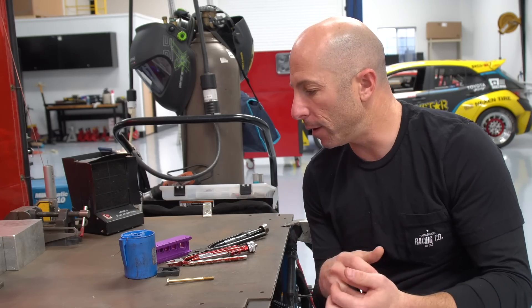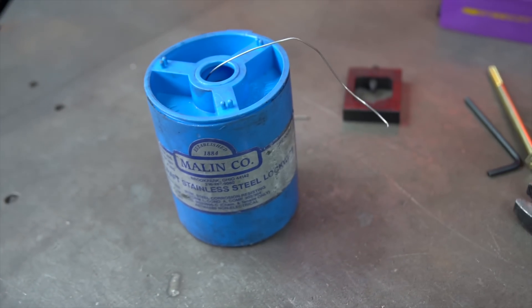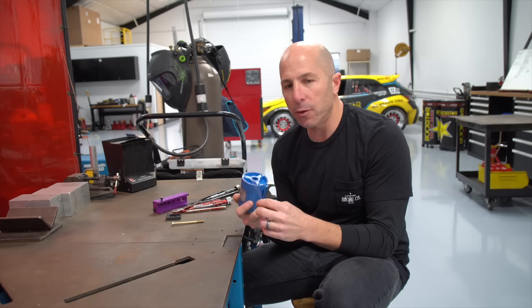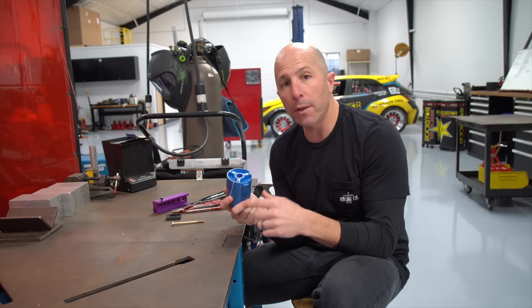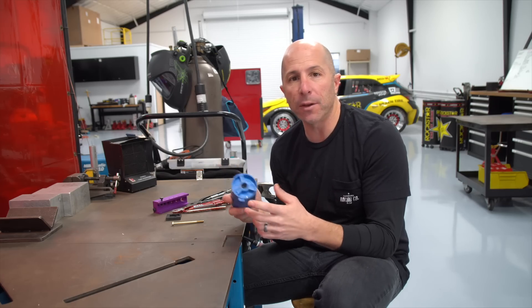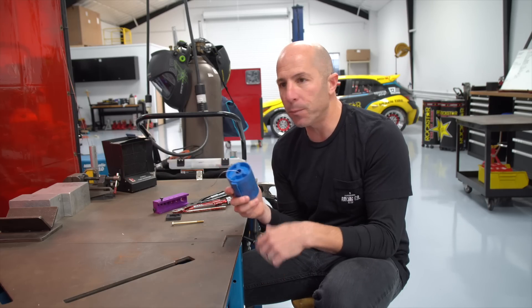There are some tools that are just universal in motorsports and even normal wrenching on cars, and one of them that we have in every toolbox is safety wire and safety wire pliers. Safety wire is literally just stainless steel wire. The really popular size is 0.032 inches — it's kind of the Goldilocks size. It's not too small and fragile, and it's not too big, so it still fits through holes you can drill relatively easily into bolts. In automotive, you're in the range of 10-32 to about half-inch or 5/8 bolts, and the 0.032 is the right diameter for pretty much all of that.